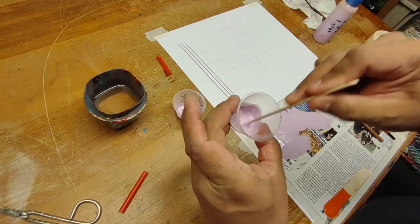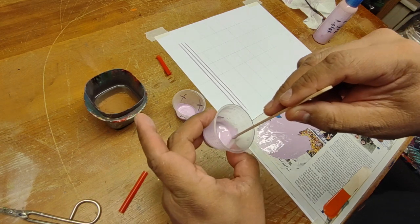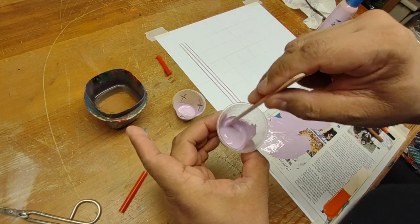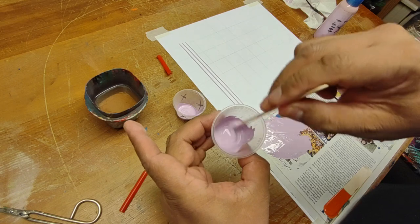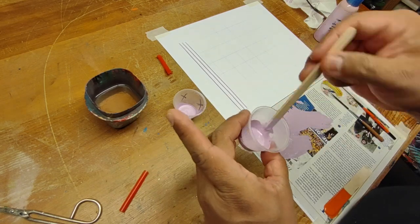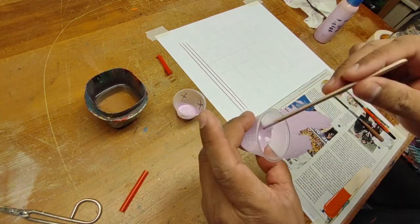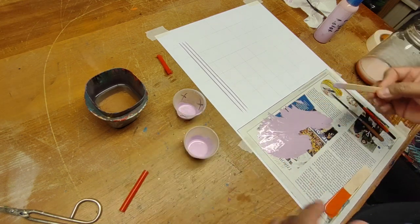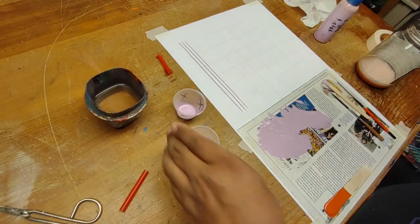Right, so now I'm looking at a paint that is kind of watery, right? It moves fast in that cup. So that tells me that it's over-reduced, how it's moving super fast in there. I wish I knew what that looks like. Maybe melted ice cream, right? It kind of looks like melted ice cream. It moves around fast. I still don't know how that feels. It might feel okay. But let's try it.